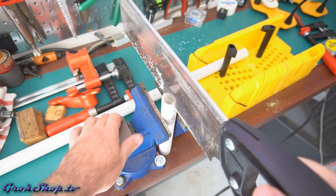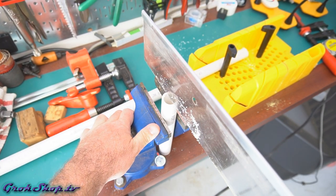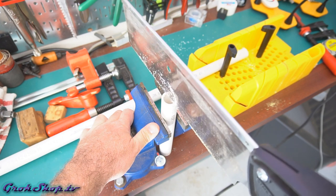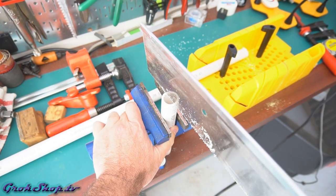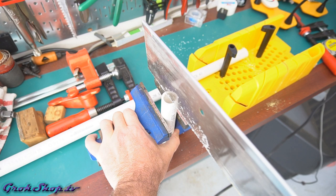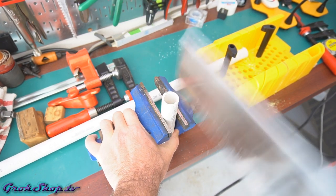To make the flanges, I just eyeballed it and cut it into 4 equal quadrants from the end, about 3 or 4 inches deep. If your quadrants aren't perfectly even, it's no big deal really, it'll still work. If you wanted it to be as even as possible, you could just measure the circumference, divide by 4, and then put a mark at your 1/4 of the way mark around the circle using that circumference.